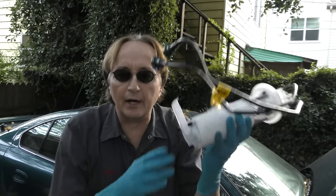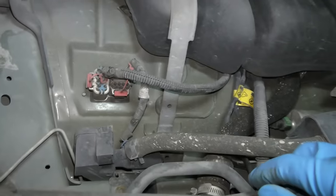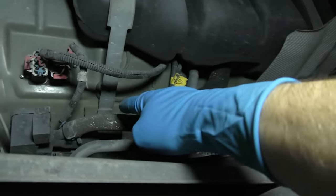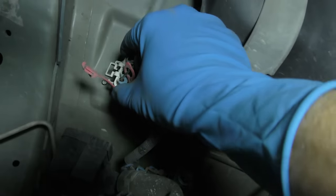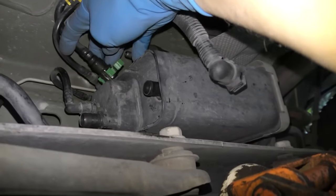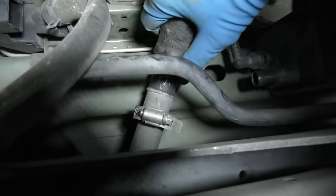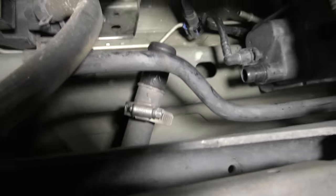So on this Pontiac we're gonna have to change this gigantic fuel pump assembly and take the gas tank off to fix it. Once we're under the car we've got to disconnect the electrical connections and take the hoses off that feed the tank. This line twists and snaps off, you squeeze the plug and pull that off, then you pry the little tab off the fuel line and that slides off — it's just a snap connector. Then you have to wiggle the crap out of the gas feed line and pull it out of the way.